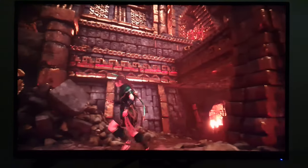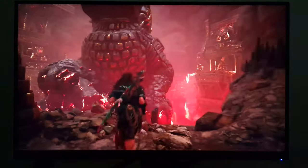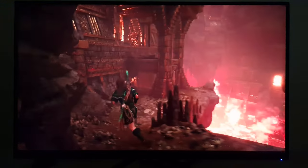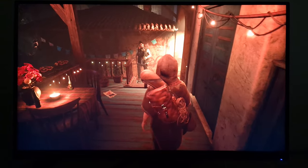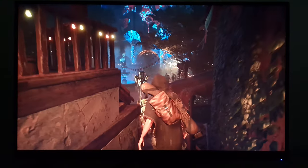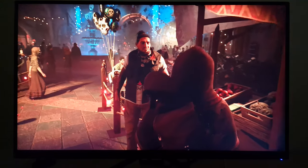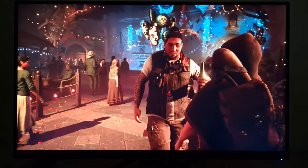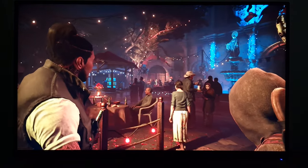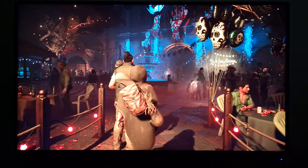If it was bright biasing more, it would eat away at the atmosphere and depth of darker shades. I'm not saying they've tuned things perfectly algorithmically, and I'll talk more about this with respect to HDR later. On another scene in Shadow of the Tomb Raider with adaptive dimming disabled, things look a lot less atmospheric, a lot more flooded — clearly a lot of shades are much brighter than they should be, even just with my test setting brightness.